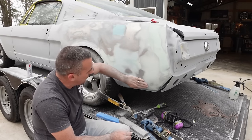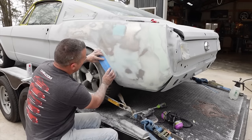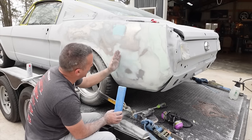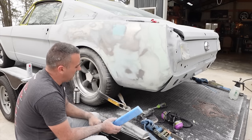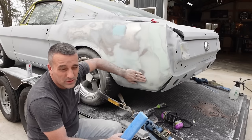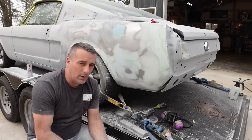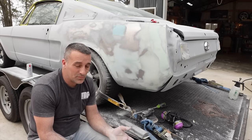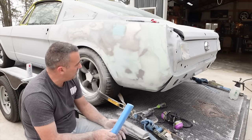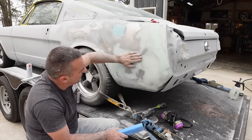As you're playing around with different pads, grits, and techniques, you're bound to get over into an area you don't want. I'm over here working on this, and I have to come out far enough to grab the whole area and blend it, but you'll start to dig into the surrounding surface. Honestly, I don't know a good way to stay away from doing that — it's just kind of part of it. You may put filler over this thing two or three different times, keep sanding and keep going back to it. Eventually it will come out — it's just going to take time. Be patient, even when you feel like you're fighting a losing battle.